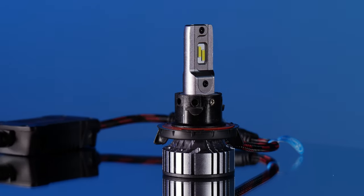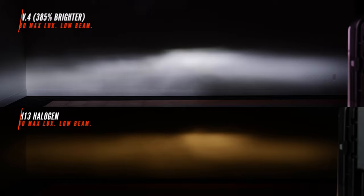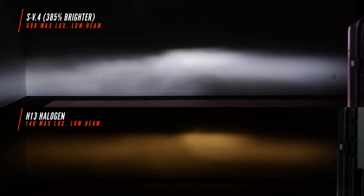This one has been on our channel quite a few times. It's always been a solid performing H13 bulb, and as you can see in the 11 to 16 Ford Super Duty headlight, it came in at 680 maximum lux. It looks good on the wall. We've got a nice amount of flood left and right. Definitely not a bad option. Let's check out high beam.